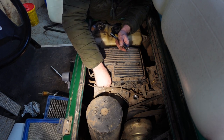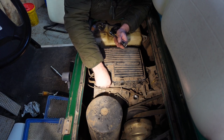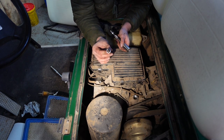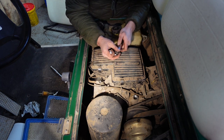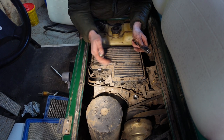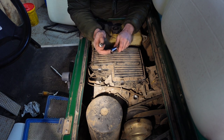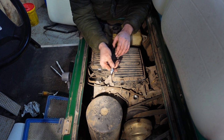But you've got to stop worrying about changing these, and service on an annual basis. If it does 10 miles or it does 100 miles, you've got to service the machine. It's sitting here, the spark plugs are going rusty. We've got bad fuel in the tank. The air filter gets a bit dusty and corroded. You can get mice in here. So you've got to change it all the time. If you're doing a couple of 100 hours, you change your service, all the parts on there that you can. If it goes on to an annual basis, you can do it then. But they must be done every year. It's no good leaving it 4 or 5 years, saying, oh, we only do 10 hours a year. It doesn't work like that. These things need to be changed.